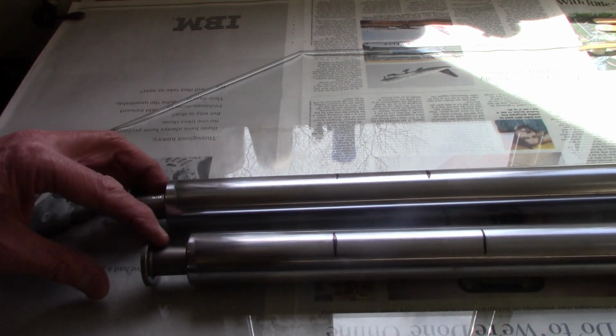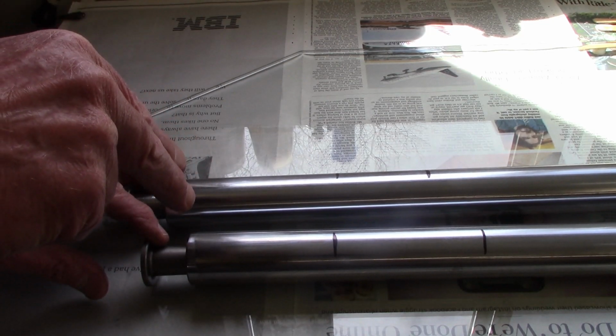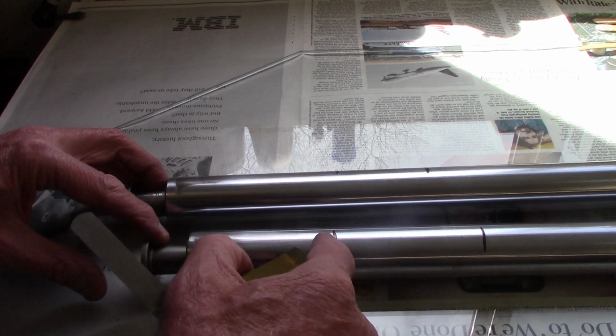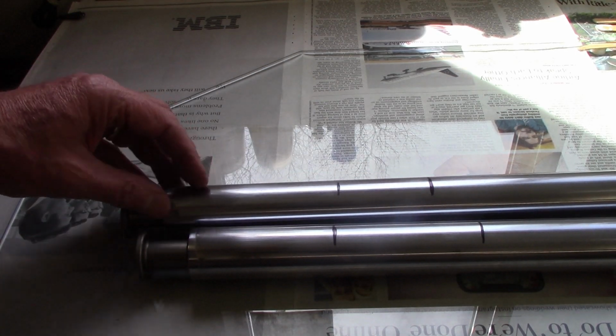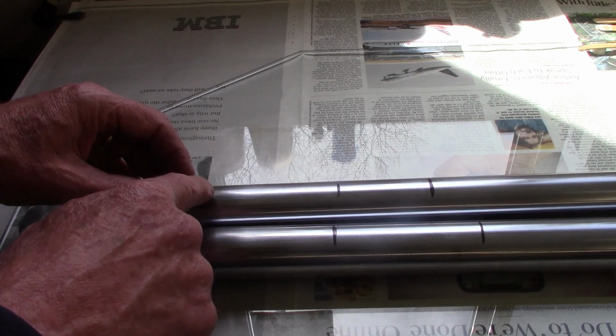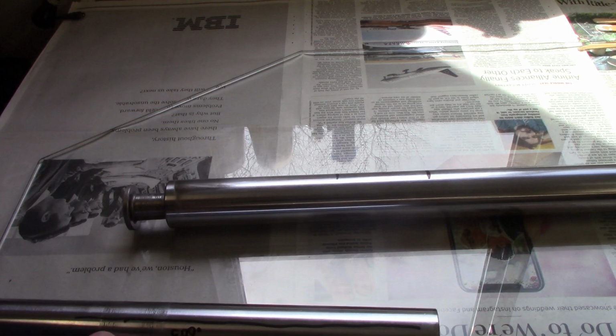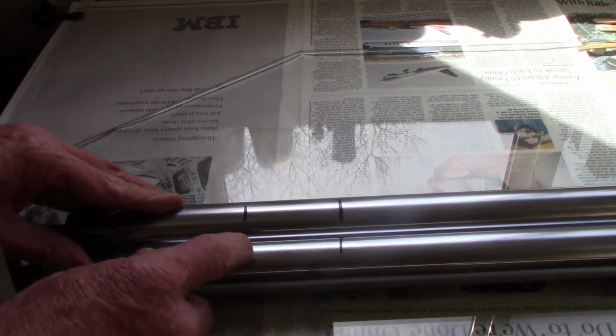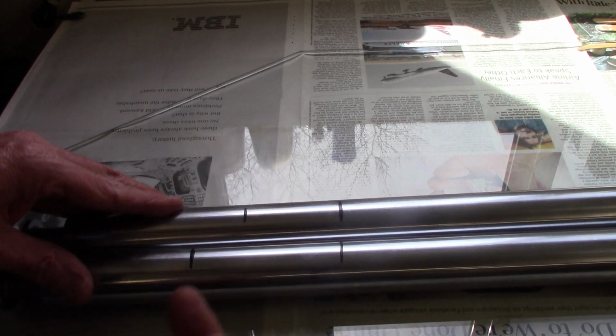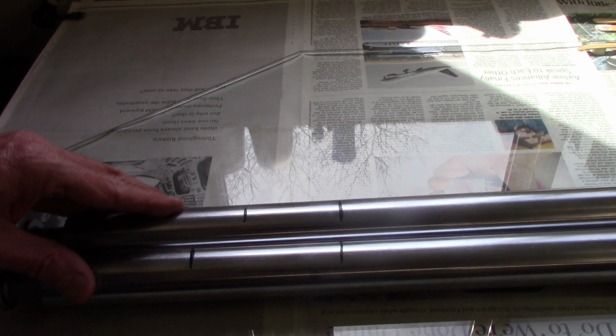And as shocks hit the front tire going this way, meaning road potholes and things like that, you get a little bit of a bend, but it's not enough to be worried about. So when I install them, I'm going to make sure this and this point to the front. And to help me do that, I've drawn a line which is on the front face of the fork tube on each of them. So that way when I go to install them, I'll just put the lines where I can see them pointing to me. And both tubes will have their slight kink in the same location, pointing in the same direction. That's going to minimize stiction of the slider on the tube, so the forks will be smoother.